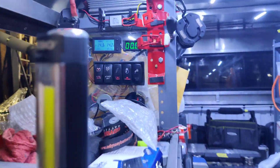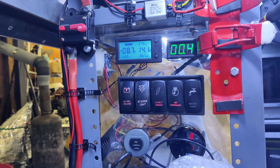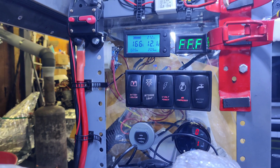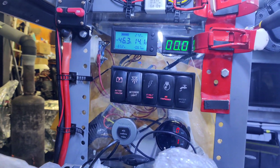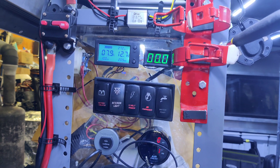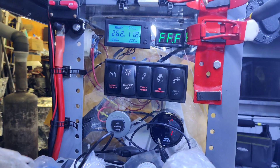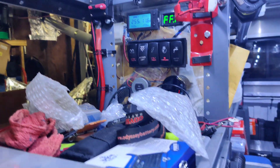Turning it up again, you can see my gauge in here is pretty accurate. Right now the alternator is charging the batteries, which skews the reading — I'm seeing 173 amps. So I shut the isolator off to get an accurate rating. With the isolator off, we're seeing 263 amps while the carbon pile tester is reading 200 amps, and voltage is at 11.6 volts.